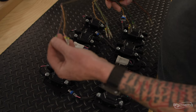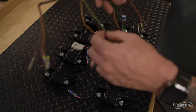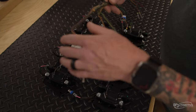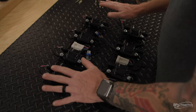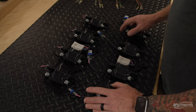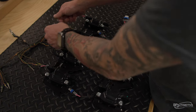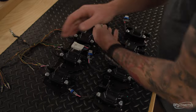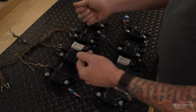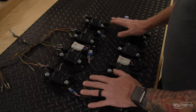At this one you'll see a purple wire. This one is light blue — it'll look green up through here just because the wire is old, but when you get down close to the connector you'll see that it's light blue. And then you've got a dark green and then a red. How these go is when you're looking at these coil harnesses, red always goes on the right. The way these coil harnesses are taped together and assembled, you can't install them in the incorrect order — you can only flip it and put it in the wrong orientation. Most of the connectors will not reach if you're trying to connect them out of order.